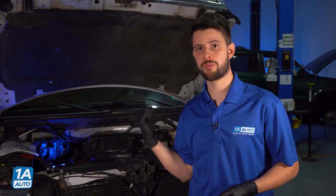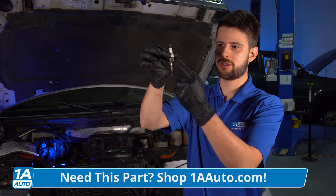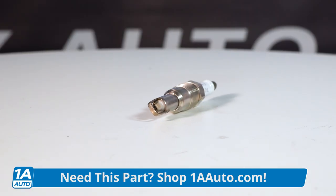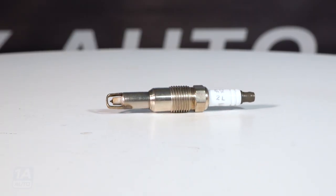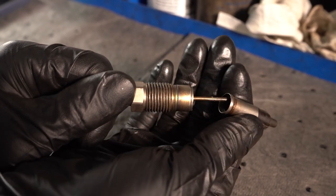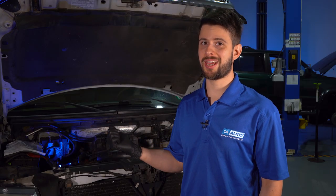However, on the 3-valves, Ford updated that design and created this spark plug, which as you can see is a lot longer. With this design they wouldn't blow out anymore, but they would be so tight in there that when you go to remove your spark plug — uh-oh, that happens. So if you're working on one of these, more than likely at least one spark plug will break on you.